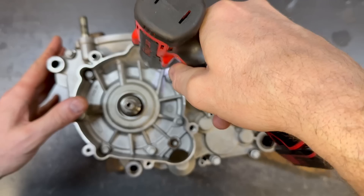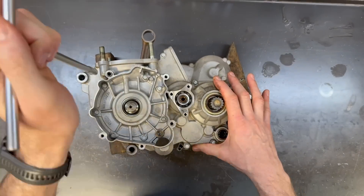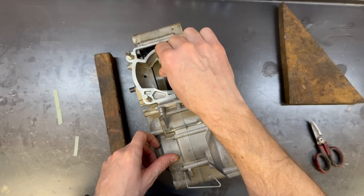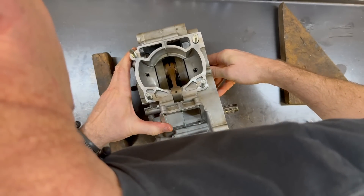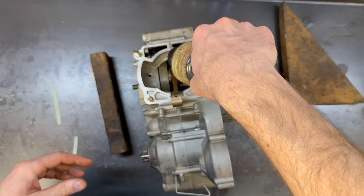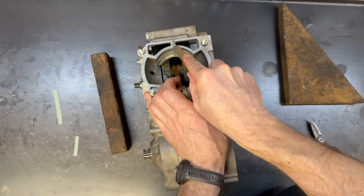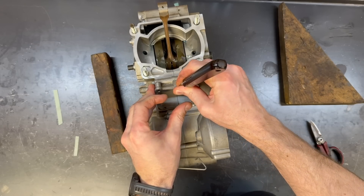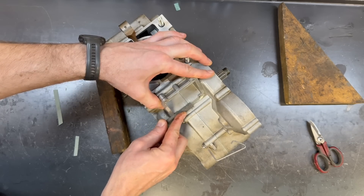I'm going to run these in — I always finish these up by hand. Bottom end assembled. Snip that gasket away there, just roughly. Nice rotation there. Now we should be able to move this crank back and forth a little bit — there we go. It's okay if there's a little bit of resistance, but it does move back and forth. We should have a little bit of end play. I'm going to throw a little bit of two-stroke oil down in that bottom end to lubricate the bearings and the connecting rod. Now I'm going to take my gasket scraper and cut those gaskets off flush with the case, and then use my die stone to flatten that and make sure we get a good seal there.